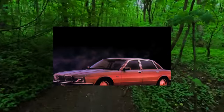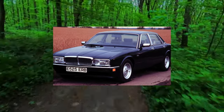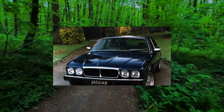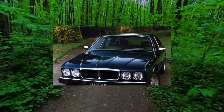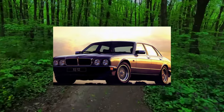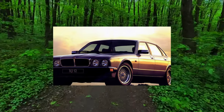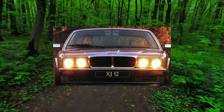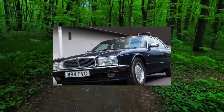From the trunk you can see the seam opening inside at the junction of the rear pillar and rear seat wall. There is no hatch in the wall for transporting long items. The problem of weak roof pillars was clearly known at the factory — the seams are treated with something like tinning, but after a quarter century this technology is losing ground and cracks appear in the metal. An unusual problem is the front edge of the door at the opening limiter installation site, where the metal cracks very well.